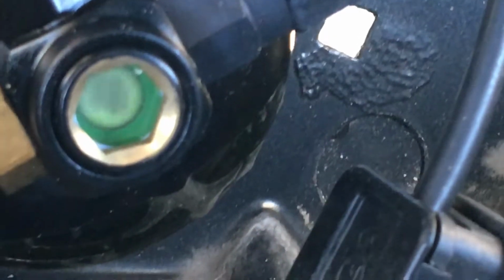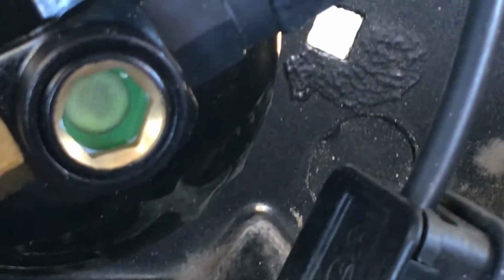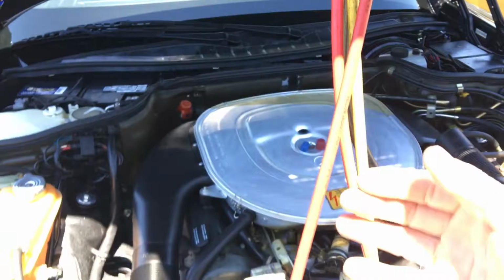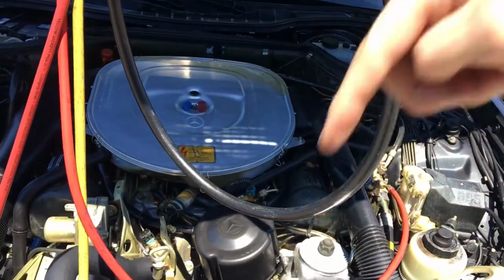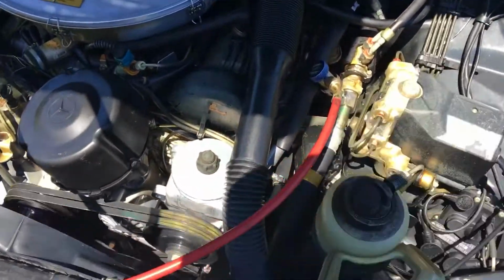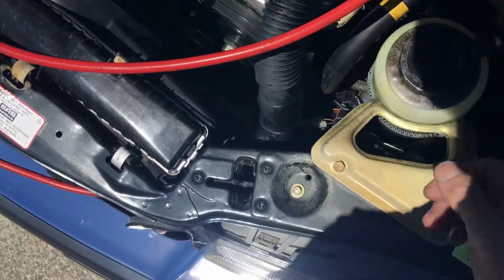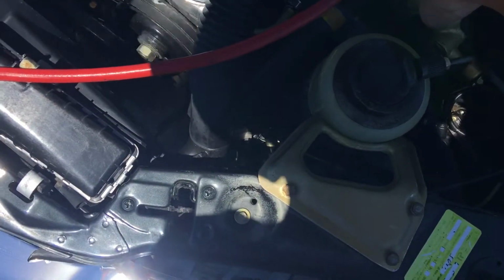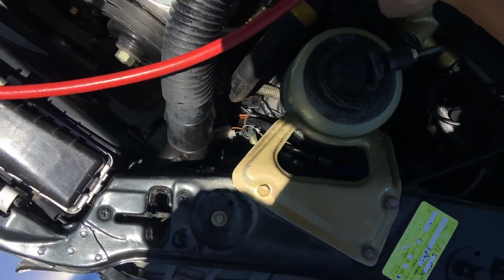This is one of the few times when you see those pressures, you have no cooling back. I can tell you that this system is low, and most likely it's not due to a restricted expansion valve, or an expansion valve stuck in the restrictive position, where it's clamping off the restriction and actually trying to hold back the refrigerant. I'm pretty sure this particular one is not having that issue. This one is just low on charge, but I'm going to double confirm that.